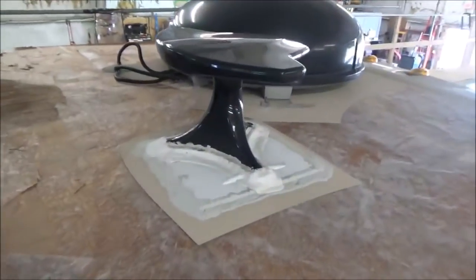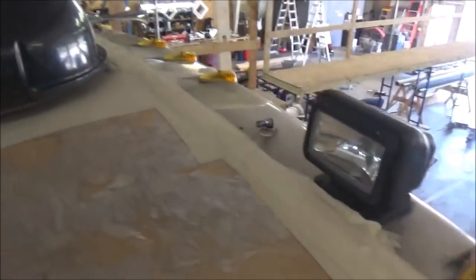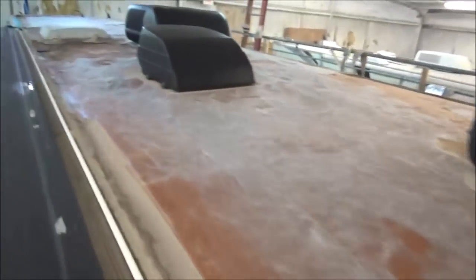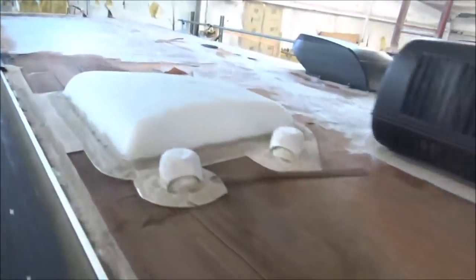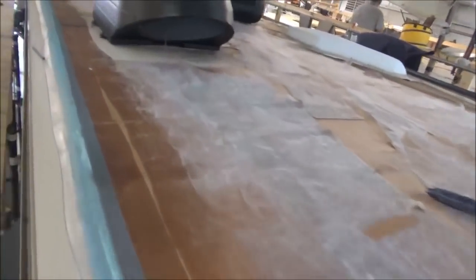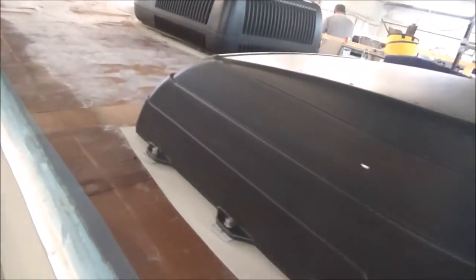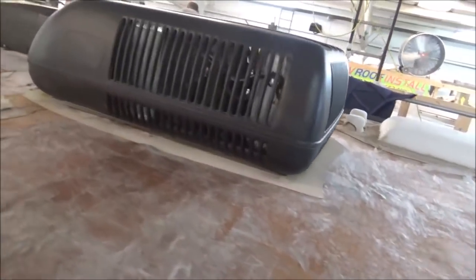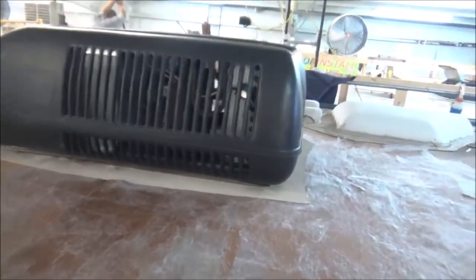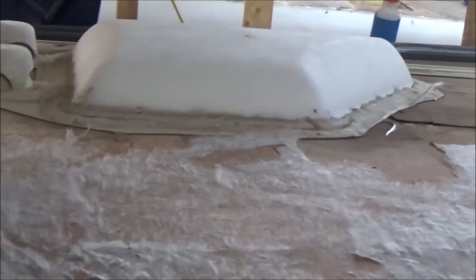Look at all this caulking all around here. We'll end up — not sure if we're going to keep that. If we keep it we'll just elevate it and put some boots on that. Let's go around the other side. You can see all I used here was drywall mesh — that's all that is, drywall mesh on the edge there. See how low that air conditioner is? That can't drain properly. By elevating them it'll drain a lot better. Look at that skylight — you can see all that caulking slobbered on there. We'll clean all that up.